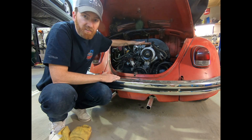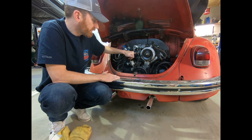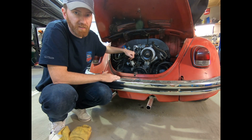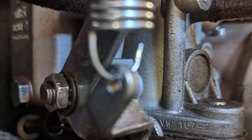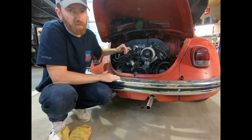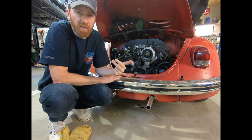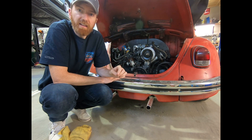The next major difference is your carburetor. On the flange of the carburetor there's a stamped number — for auto sticks you want that to be a 167. The next number after 167 indicates type 1, type 2, or type 3.